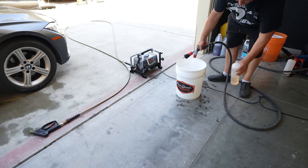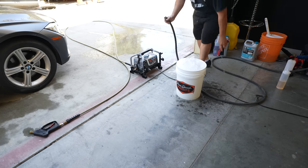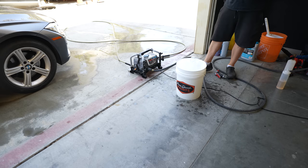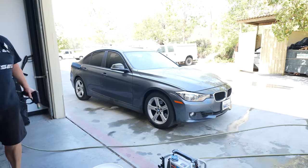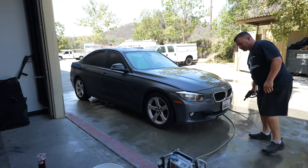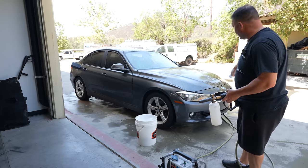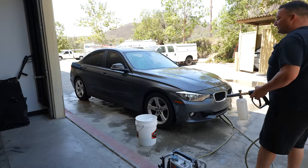With the quick connects, if you want to go quickly between your hose and the pressure washer, all you have to do is push in, pull back, come in, push that on. We'll put our soap in for our sponge — they're at Home Depot for about seven bucks and saves a ton of time. Now we'll load up the foam cannon and get started. Before we foam cannon, we give the car a really good rinse, spray the wheels down with wheel cleaner, and then spray small areas around the headlights, bumpers, grille, mirrors, trunk area, and fuel door before hitting the big areas with the sponge.